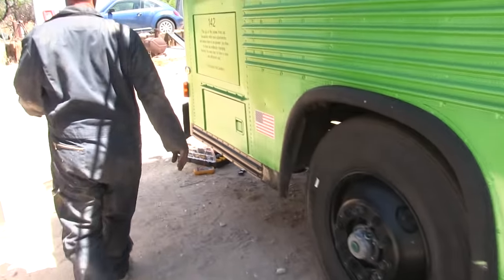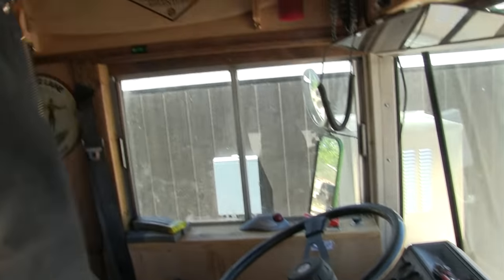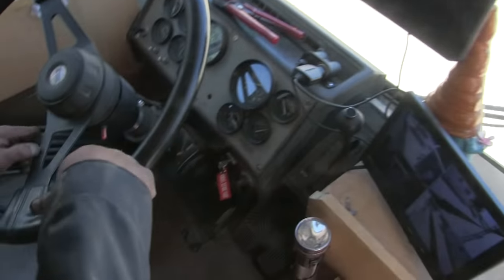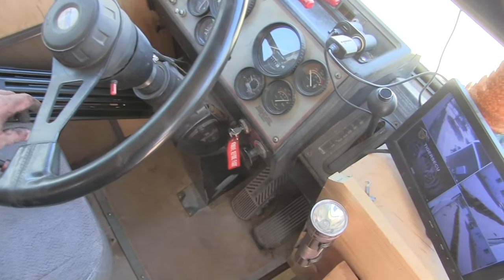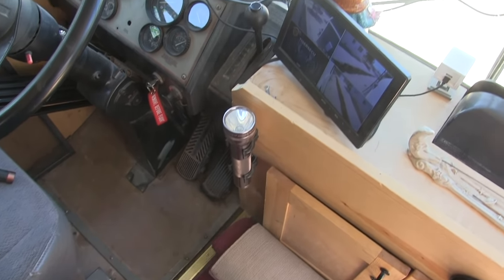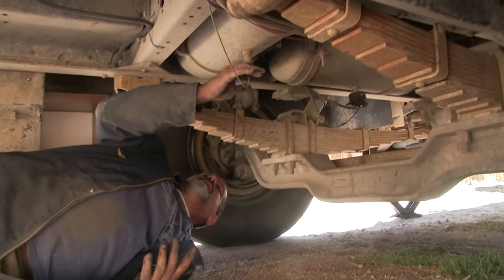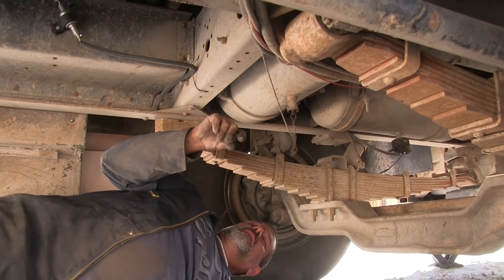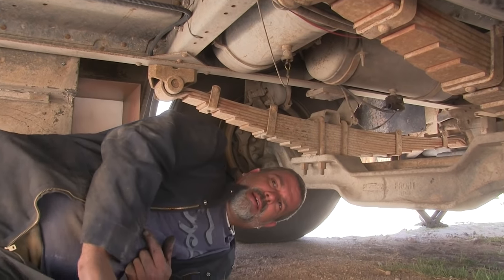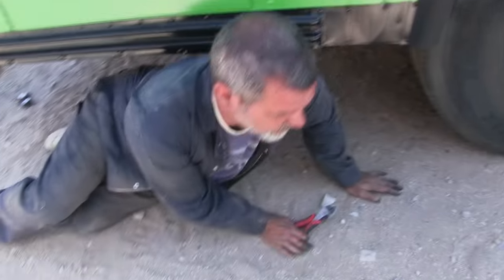Let's turn it on and see if there's hissing noises or explosions. What's that front one up here? It's leaking — something else? Oh, it was just a simple little thing. That solved that issue — it got stuck open and was draining the tank. I'm so glad that was not going to require another new part. It fills up at about 90 PSI — fills up our auxiliary.